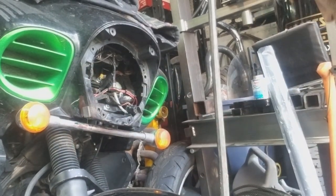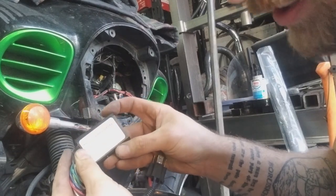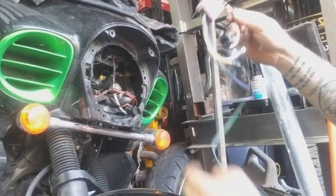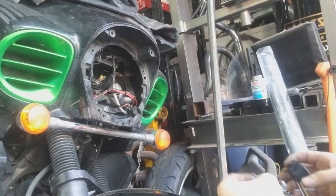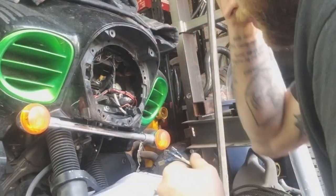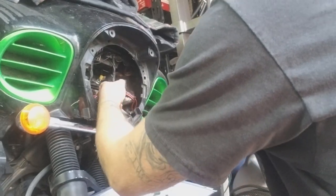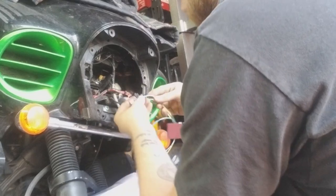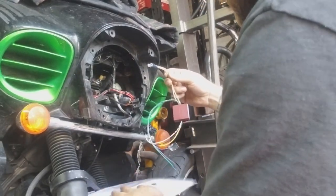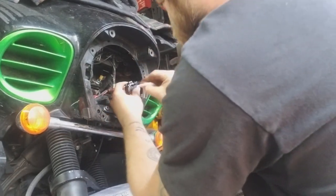I've removed the old modulator — the old one for the incandescent lights, if anyone's interested. The Diamond Star. I love these things — they really do make a difference. I've had several bikes and getting that installed on any of the bikes, there's been a marked improvement of people not pulling out in front of you. Okay, so black on the right — that's ground. The only thing I dislike about this new one is it doesn't come with the connection. I think that's because these are standard no matter what: it's always ground, low, high. So they should give me the male connector because this never changes.